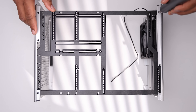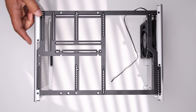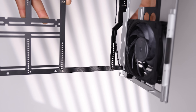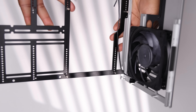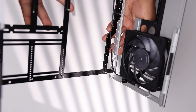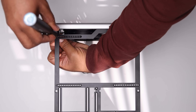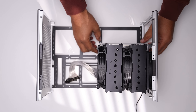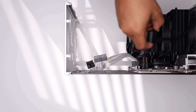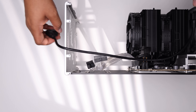We are going with the reference layout. I'm going to install the front and rear panel to the back plate first. You'll need six countersunk screws — five 5-millimeter countersunk screws and one 3-millimeter countersunk screw on the middle screw hole on the front panel. This gives the case its first structure. To seat the motherboard, install the standoffs next. I'm using the very top position to give the GPU a surplus of fresh air from the back side. Secure four standoffs using four countersunk screws, then seat the motherboard and secure it down with four flathead M3 screws. Remember to install the power button and PSU extension cable early — doing so later could be impossible.